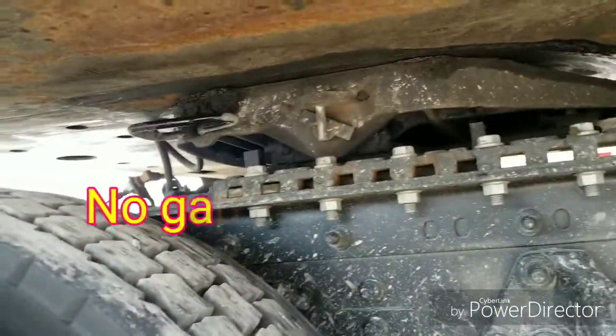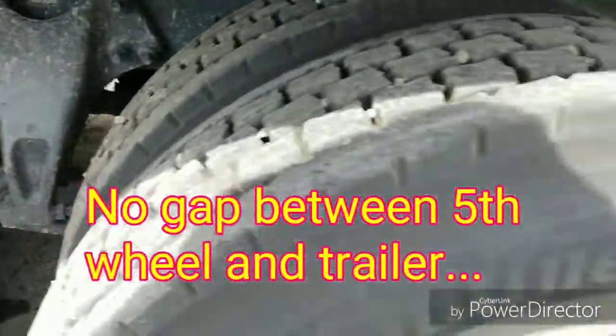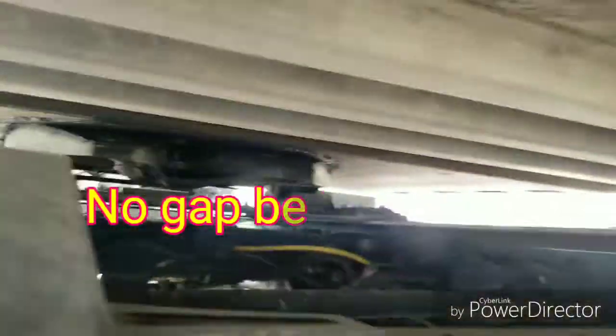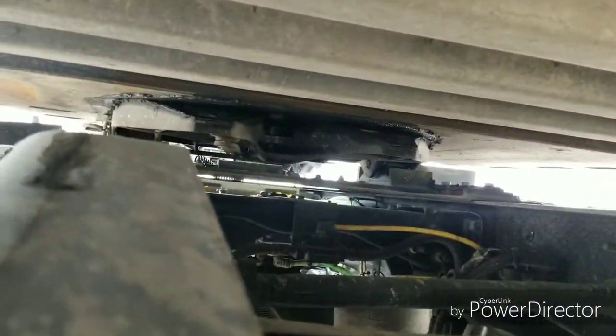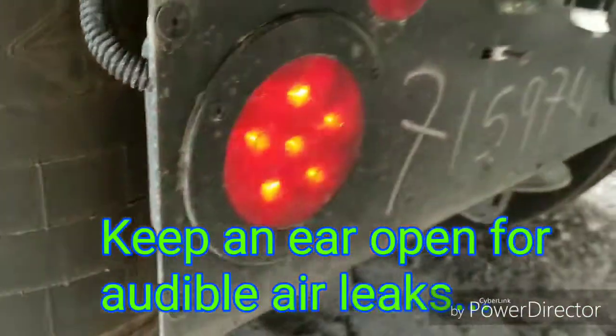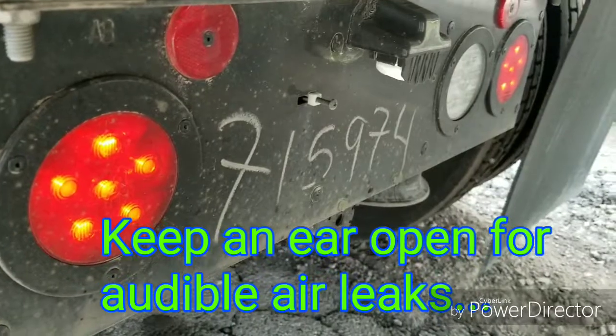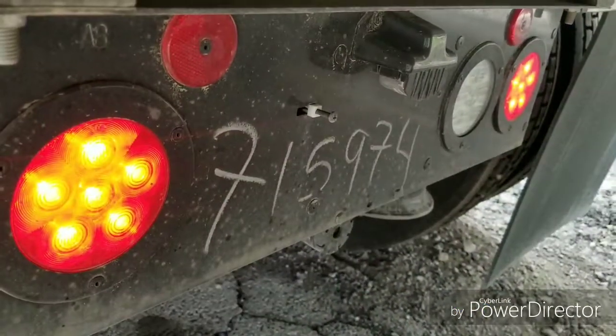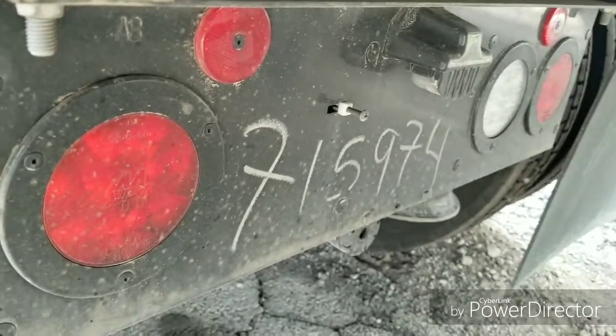I want to make sure your handle is pushed all the way in. You want to come underneath here, make sure your fifth wheel is engaged, make sure your fifth wheel is locked to the trailer. While you're back here, you're checking your lights, making sure those are working. I got the light test on, so it'll check the brake lights, turn signals, the whole shot.